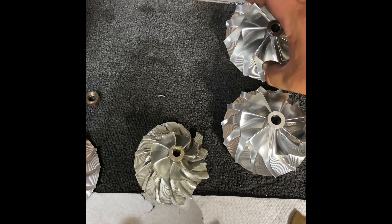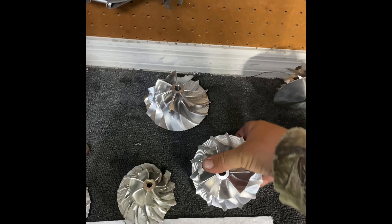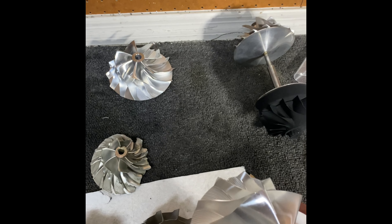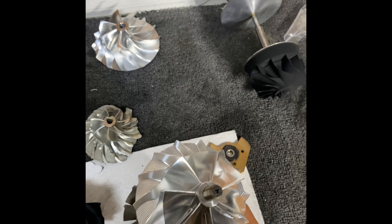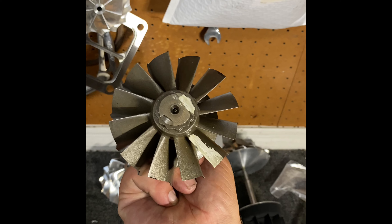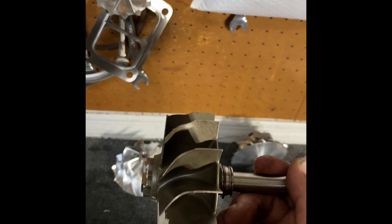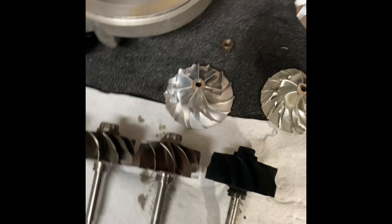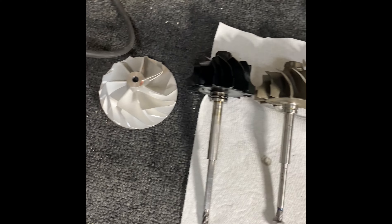Or an 82 or an 85 — I have this beautiful 85-millimeter wheel and this 80-millimeter wheel. The rotating mass on the 60s is just insane. The 60s are more robust than an S-400. Thrust pads, thrust collars, journals — everything is tougher on an HX-60. And the 3.6 flows massive amounts of exhaust. Highly suggest HX-60. Anyway, back to the HX-50, 52, 55 — if you guys have any questions, just let me know in the comments.